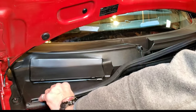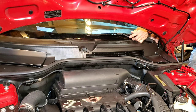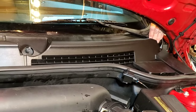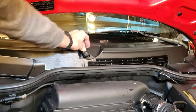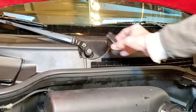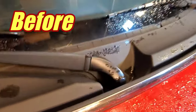Put the weather strip back on — it has little dog ears on the ends, and you want to make sure those go to the outside. This one's in good shape. Get the wipers back in using the alignment tape, then tighten down the 13-millimeter nut and put the protective cover back on — it just snaps in place. The passenger side is a little bit easier; you can get a ratchet on there so it goes faster. Close the battery hatch, close the hood, pull the tape off. This was a very good repair — a big upgrade from the original.